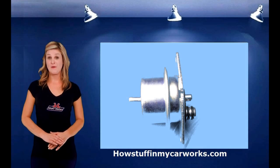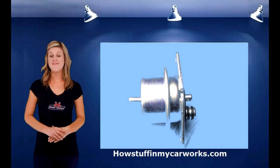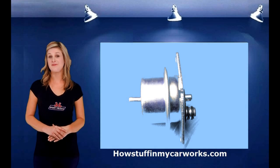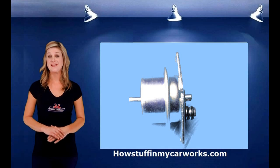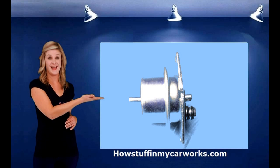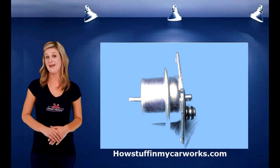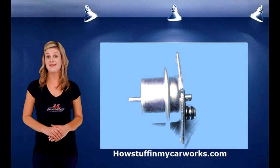When the vehicle is at idle, the fuel pressure is lower, usually 5 to 10 psi depending on the vehicle. The high vacuum inside the intake manifold allows the regulator to lower the fuel pressure. The vacuum signal is sent to the regulator by using a vacuum hose attached directly to its top or its side depending on its design. The most common mounting position for the fuel pressure regulator is at the end of the fuel rail. This way the fuel pressure remains constant.